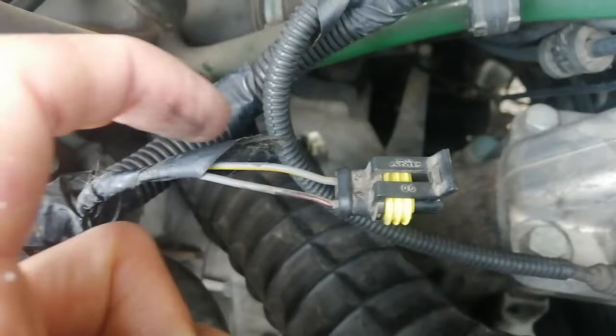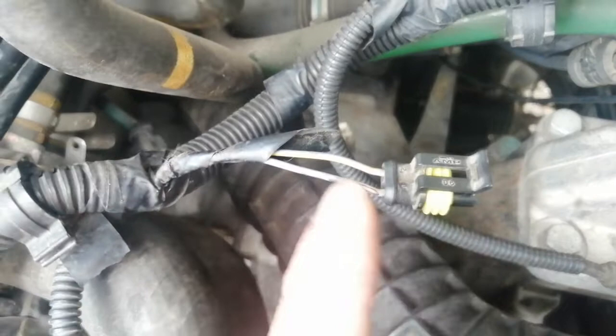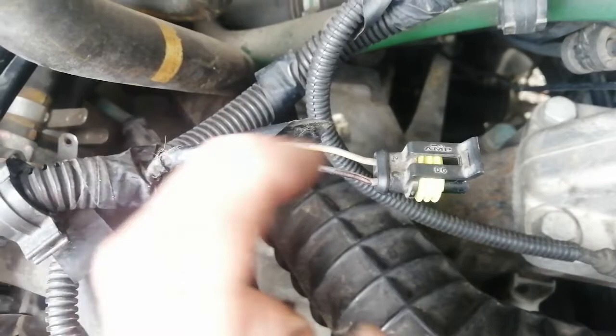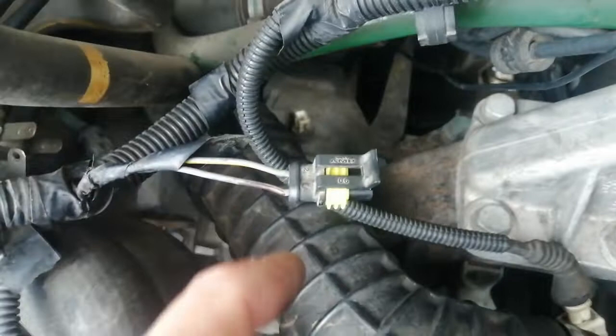Because I've done some tests with the test light and multimeter, I know that it's this one which goes into the cabin — into that one that I've depinned. This one goes into the loom and goes further on, and I know it goes further on because here there's only one gray and yellow.